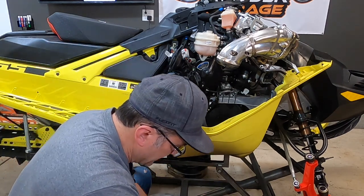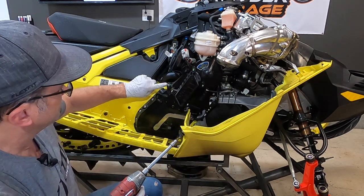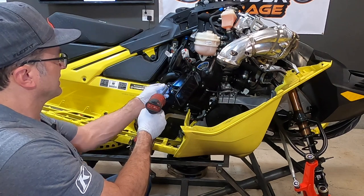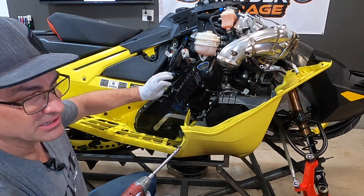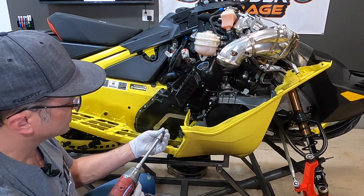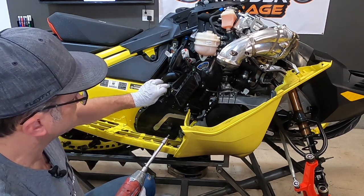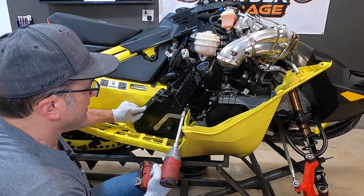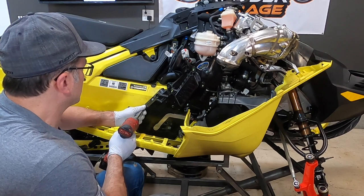It's a little bit different than the other bolts we're going to be working with. The next ones are our T30s — there are 8 of these silver ones around the perimeter. I've already pulled most of them off so this video doesn't take as long. Before I did this, I went around with a ratchet and made sure all of them can come loose easily, because I've seen people strip out the Torx heads since they can get stuck in there. Make sure you don't just hit everything with an impact wrench first — it makes it quicker, but you can strip those out. Loosen them first with a ratchet.